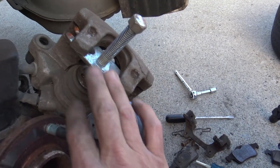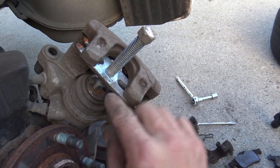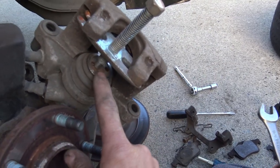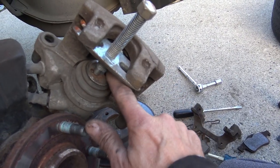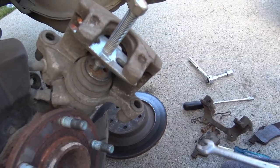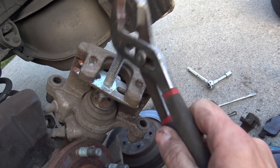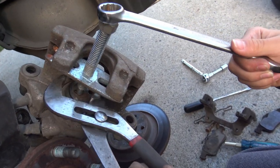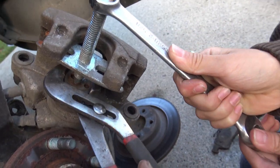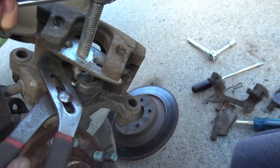I have this in my toolbox — you may be able to get it somewhere. There are professional tools that will apply pressure this way, but basically this is a wheel puller. When you rotate this it applies pressure, braced up against this part of the caliper. Then I rotate the piston with my channel pliers. I shall demonstrate with the help of my assistant. This is Liam. Liam is going to turn this slowly as I turn the piston. Okay, let's go. I'm turning, Liam is turning, we're applying pressure, and the piston is steadily going down.